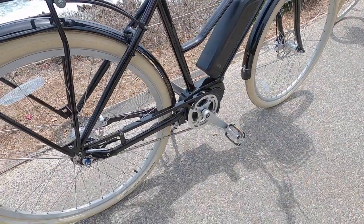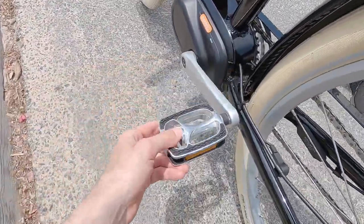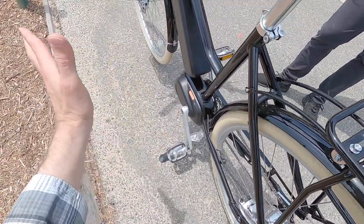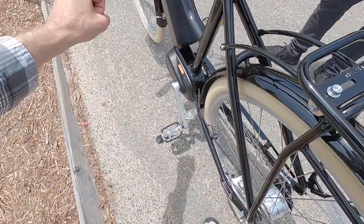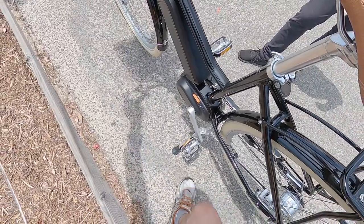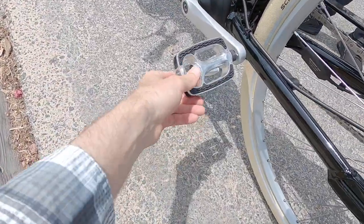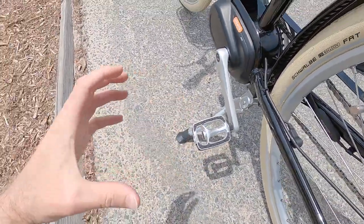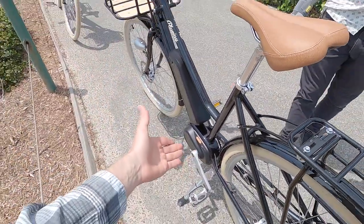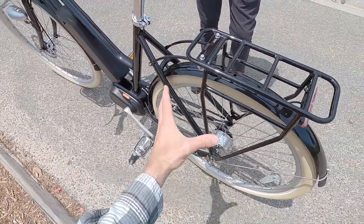The drive train on this bike is really nice. But before I get into the details, I do want to mention that because of the kickstand placement, you can get pedal lock. That happens when you back the bike out of your garage — you've got the kickstand down because it's a tight space, you end up locking the pedal and then the bike won't go back. Please keep that in mind. You can tip the bike up onto the kickstand and pedal forward a little bit. The kickstand itself has a nice big plastic foot with plenty of space so it doesn't sink in as much on soft terrain, and it's adjustable length.